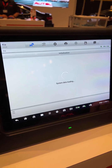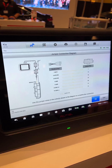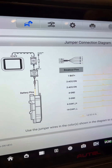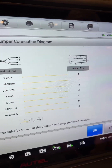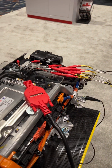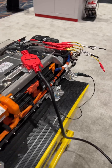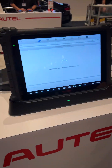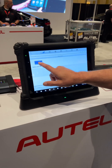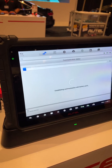Now it's going to load the system data. It comes up and it tells us how to connect our cables to the low voltage side of the high voltage battery pack. We've already done that, so we'll say okay. It's going to establish communication with the battery pack. I go ahead and hit the battery pack information button.